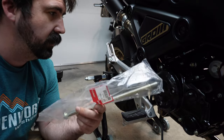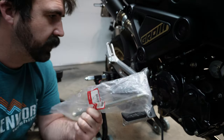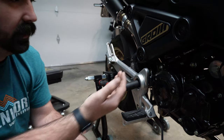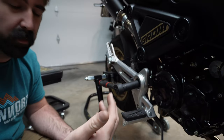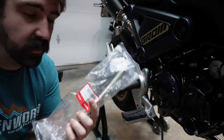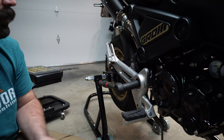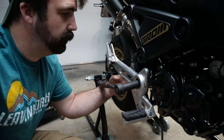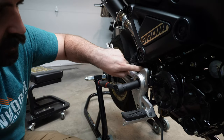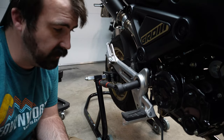I bought the swingarm axle bolt. It is a few millimeters, half an inch, I don't know, shorter than the stock Grom one. You can use washers in behind to space out the peg and reuse existing stuff, but I figured, well, we're in here, might as well do it right with a $8 axle or whatever. Gonna have to unbolt the master cylinder back here, as well as get the brake light switch off and a couple springs, but that should all be pretty easy stuff.